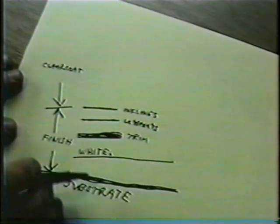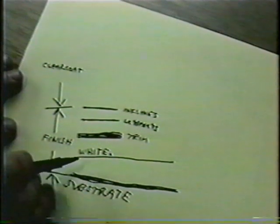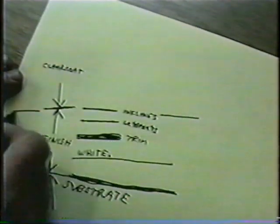Now, if you've let each coat dry out 24 hours, gas off, right up to this point in time where you're going to do the clear, this should be in really nice shape and have everything except it'll still be dull, and you want to get some clear on there to make it shiny.